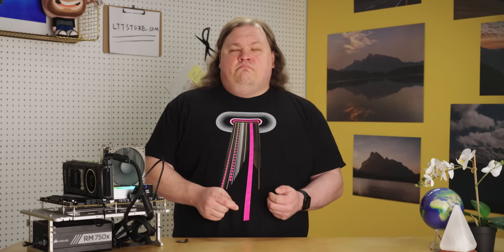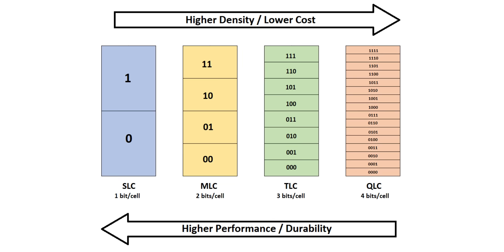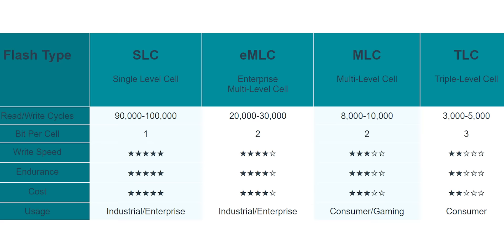In fact, binning is what leads to CPUs like the new 12900KS, which is literally just a 12900K but clocked a bit faster. In this case, binning isn't the only factor affecting performance — lower quality controllers can also influence speed, and I bet this cheap drive has a very low quality controller. There's also another reason these things still go for 90 bucks: this device uses SLC, or single level cell NAND. It's the most basic form of NAND — it only accepts one bit per memory cell, but it's also kind of the best. The TLC or QLC NAND in modern SSDs hold three or four bits per memory cell, allowing for much greater storage capacity, but this comes at the cost of speed and reliability, which in a server setting isn't ideal.